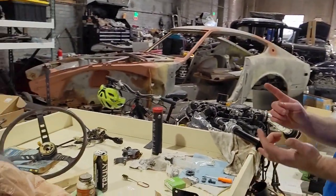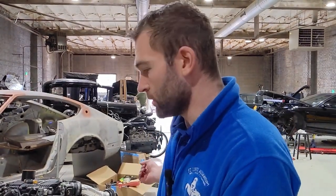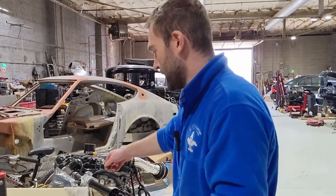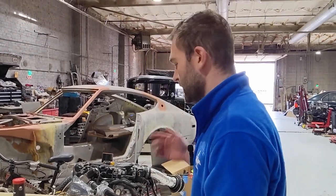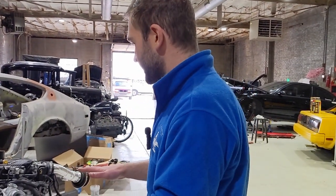And that's important because when I get this new crossmember and engine mounts for the VQ, we have to align the actual engine mounts and move the engine back and forth before picking the location. The steering shafts that go from the column to the rack can interfere with the front cover a little bit. So I want to have these mounted up and ready to go, so we can adjust the engine into the spot where it won't interfere and I won't have to grind stuff away or replace U-joints and things like that. I know this seems like a weird thing to do, but since my dog broke my elbow, it just made sense to get this ready to go so that I don't install the engine and then can't actually turn my steering wheel.